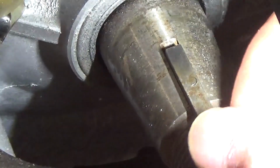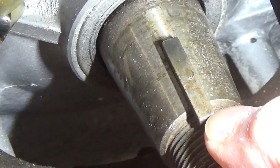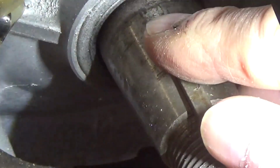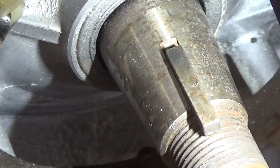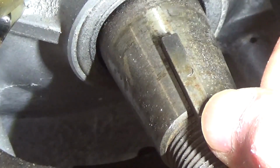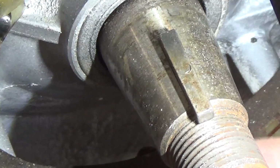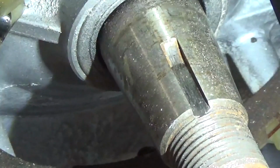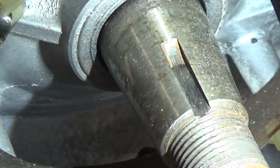What happens is that it sticks out beyond, and as it goes up, it would push the back of the flywheel up. And I think what happened was I slid it in, and then when I started cranking the thing down, the washer comes up against the back here, and it would have pushed that right up and pushed it in, and it would have forced the bottom side to come up on the flywheel, which would explain why we had that groove that was worn on the inside of the flywheel.